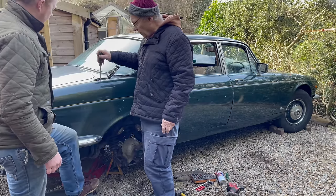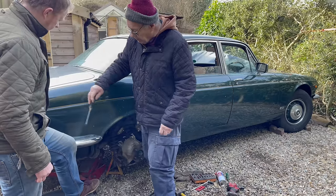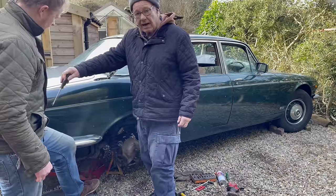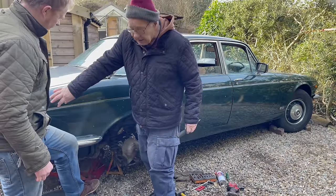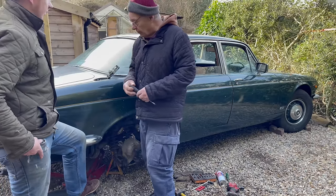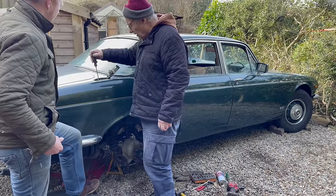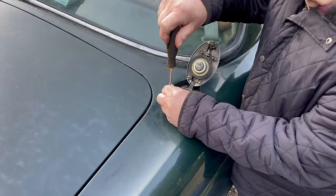We're going to take the top off now, take the bumper bar off, take the bolt out round it. The centre goes into the centre of the tank for the gauge. The wires take off, which is at the back of the tank. So when we drop the tank down, we'll be able to take them wires off it. We'll take this off first, off the top of here, the filler cap. We'll unscrew the filler cap.